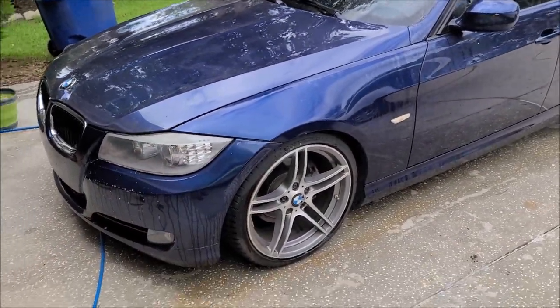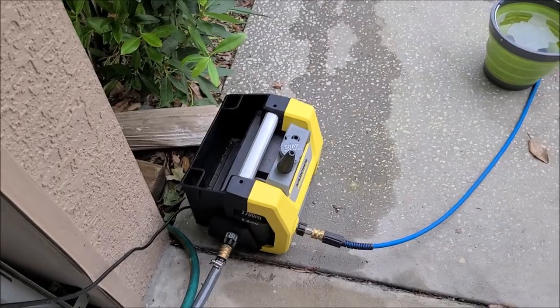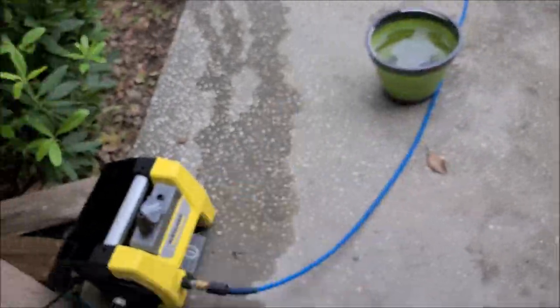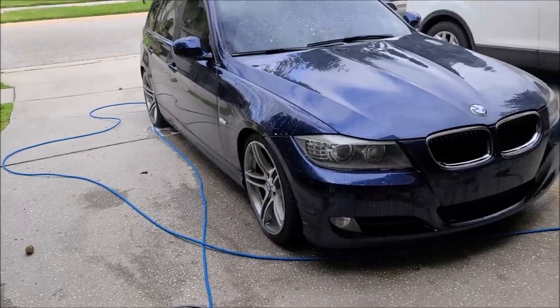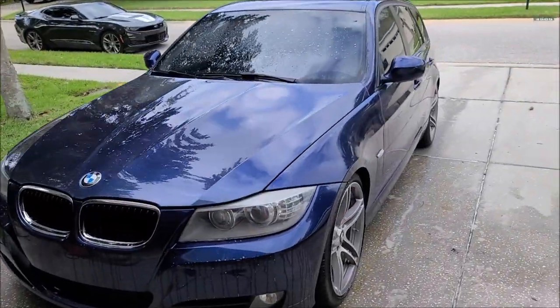For example, I just hit it with the water and pushed it all up this way, so now you've got debris all over the exterior. To avoid that, you do the engine bay first and then shut the hood. So now I don't have to push all that out later. If I'm doing an engine bay I'll always do that first, and the next step is to wash and decontaminate the paint.